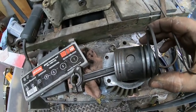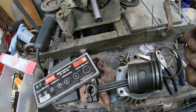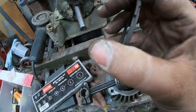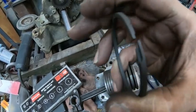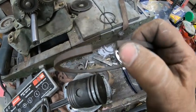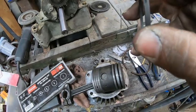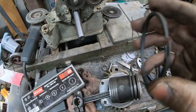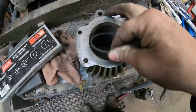I don't want it bunching up in there and breaking something or scoring the cylinder walls. This one's a little trickier to do end gap because it's almost like a hydraulic ring — this one will almost perfectly hold the compression. There are all different types of rings — this style here, 45-degree cuts, one that goes over and one that goes under. I'll go grab my feeler gauges and put the ring in the cylinder to make sure we have our proper end-to-end gap.